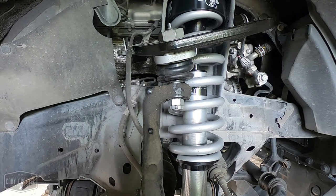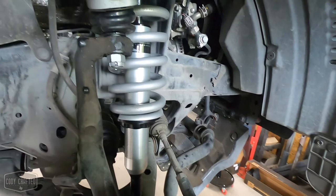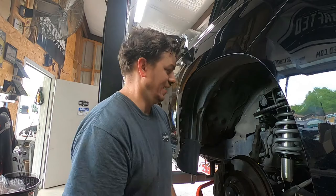I'm going to put a couple pumps of grease in the ball joint, lower it down on its suspension, and tighten all the loose control arms because we did do the rear, and the rear control arms are all loose right now. Put that sway bar link back on, and this dude goes to alignment. We'll do a measurement check, a height check, once we get it on the ground, to make sure it's still sitting level. Yeah, this car was within an eighth of an inch, which is pretty crazy for a GX460 because a lot of these are half inch, 5/8, 3/4 of an inch low on one side. But we should be pretty close. I think the KDSS is broke in on this one. So let's drop it like it's hot.